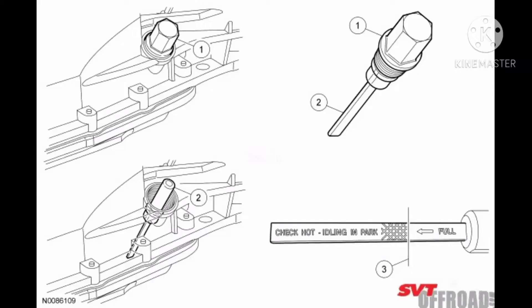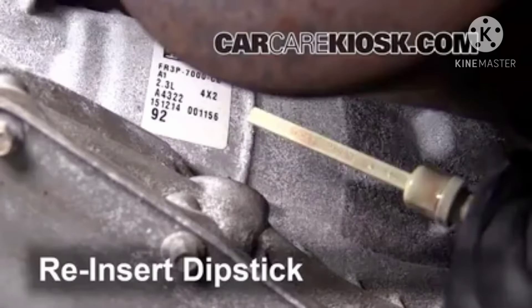This way we open the plug and you find the dipstick inside the plug. Take it off, then use your machine or whatever method you're using to drain the fluid. This is the dipstick. Just drain the fluid — you're going to take four quarts out of the car.